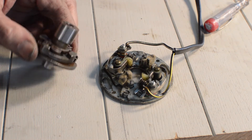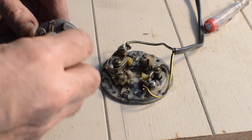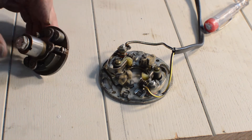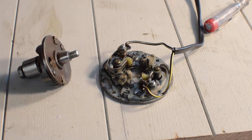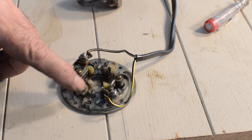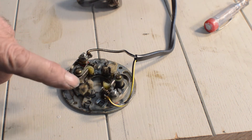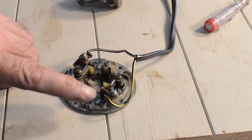Auto advance unit — unmarked, very very minor polishing but it is very very minor. Springs are good so it's going back on via its long thin bolt. I just suddenly realized I didn't show you the oil seal that fits in the case that that goes into — you'll find it in the manual. There's an oil seal in the inner case that is fitted to protect that, which I forgot to show you. Then our points plate — still got its little fibre pads that you oil to keep it all lubricated. So it's obviously been adjusted because there are marks on the screws, but the points are in very good condition. I've cleaned the faces — no pitting, no peaks, nothing. So I'm going to reuse them.